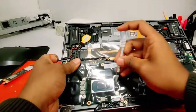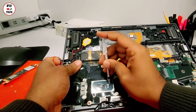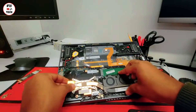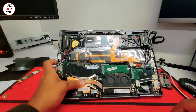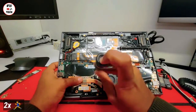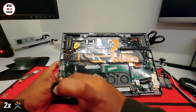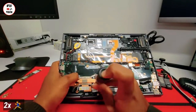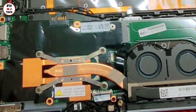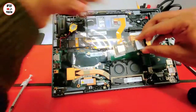Now apply the thermal paste — remember it's just a small portion, don't apply too much. Let's install the heatsink with the fan. Remember when you put the fan, you want to do the screws in a numerical position — it should have little numbers indicating the order — or you can do it forming an X. That way it helps spread the thermal paste evenly. Don't forget to connect the fan. Put it in front and with your tool slide it all the way in.